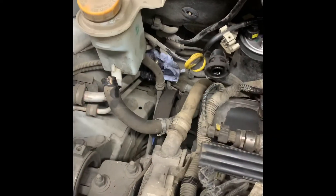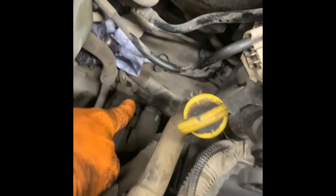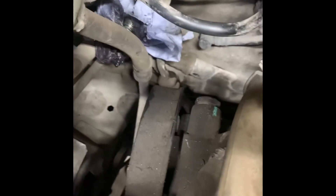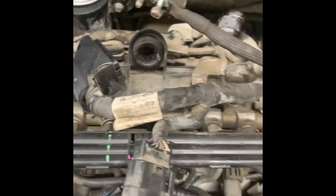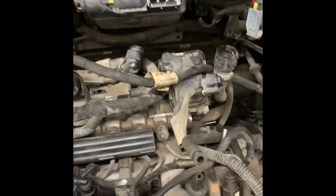Go to the top again now — one more hose to the power steering — and we're ready to drop out. This is the last pipe to disconnect, on the back of the power steering pump. That goes with the engine. Now go around and check you've disconnected every hose and anything that's associated with the van itself.